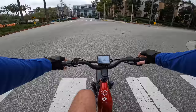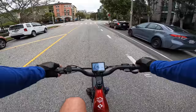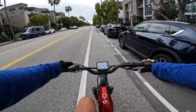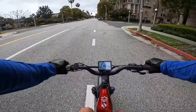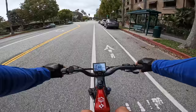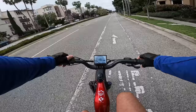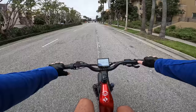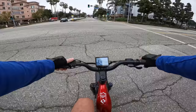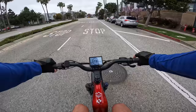Pedal assist 2 brings you up to about 15 mph. Bumping to pedal assist 3 you can go about 20 mph at around 600 watts — the levels are nicely laid out in jumps of about 200 watts. Pedal assist 4 gives 800 watts and brings you up to about 23 mph — pretty predictable. Pedal assist 5 peaks at around 880-900 watts, bringing you up to about 25 mph. So 880 to 900 watts seems to be the max output from this controller.